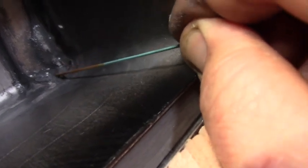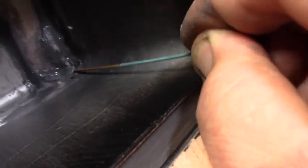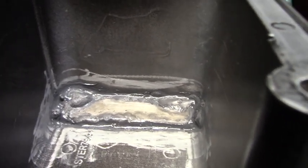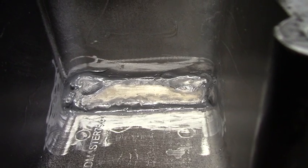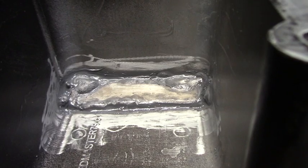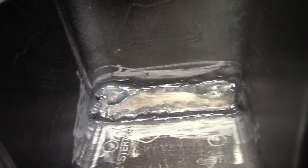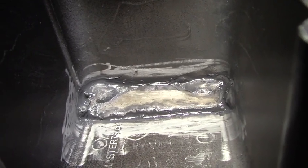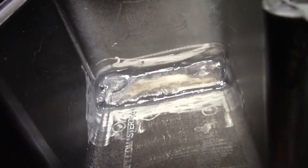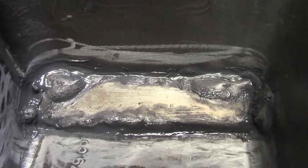You can smooth your compound into the joint. The epoxy remains in a liquid state for many hours, so you want to be conscious of how the part is placed — otherwise it may flow away from the joint. You kind of want gravity to take it into the joints where it should reside. I'm going to angle this valve cover up a little like that so it'll sink down into that corner. That's a pretty good application for it as a sealant.